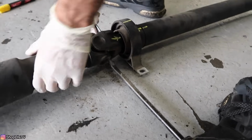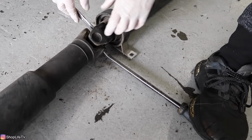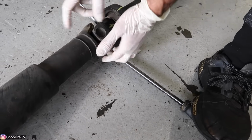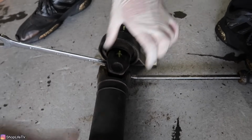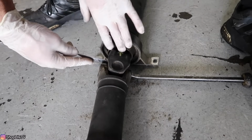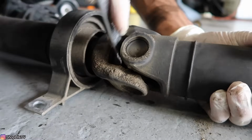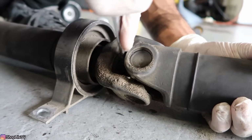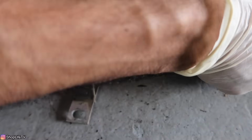On the 325s, you're going to have a lot longer shaft where the bearing has to go through. So you actually don't have a bolt. You should be able to just loosen the actual boot cover, whatever it is. It's going to be a little bit bigger and it's going to be on the outside. Loosen that and then you should be able to pull the two halves apart. You'll see on this, once I get the front half off, that the spline section is actually really short. After a certain point, you won't be able to fit the wrench in there anymore, so just separate the two halves. You should be able to just pull them apart like that, and then you can keep going.